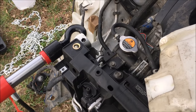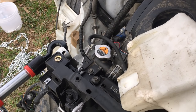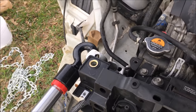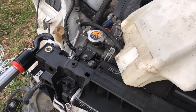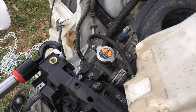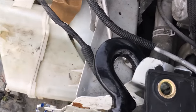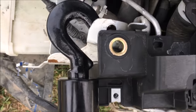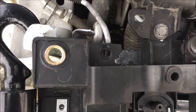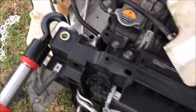You can see it's starting to pull it little by little — about a quarter of an inch or one eighth of an inch at a time. We'll just keep doing that. I'd hate to damage the radiator support. As you can see right over here, it's starting to realign up top. Towards the end I might have to just hammer it in to straighten it a little more using a hammer or sledgehammer, but for now we'll just keep pumping.